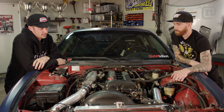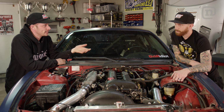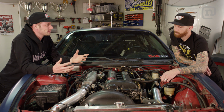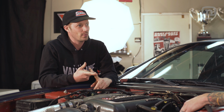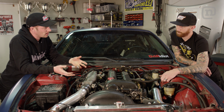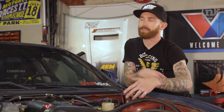Absolutely. I mean, coming from a JZ guy, where I have a JZ in an S chassis, an S13, JZ in my FRS, I love the big power inline 6-cylinder that the 2JZ produces. A really solid engine setup, but there are other factors involved. The engine weighs a lot more. Definitely. It costs a lot more to swap into a car than an SR from an S13. Yeah, and if you're going to put a big motor in that, you're adding a lot of weight to the front, but on those pro builds, guys are putting a lot of the weight in the back. They're shifting things around to make their car more balanced.